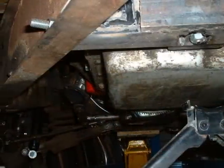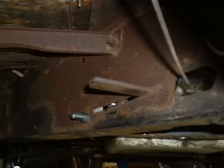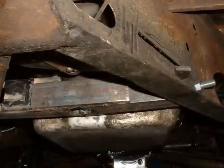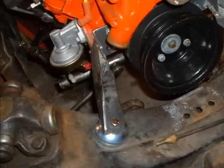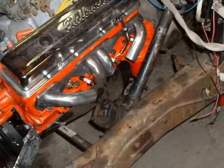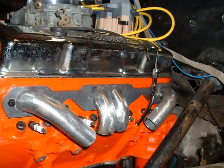You can see some of the detail. I centered the tailpiece in there where it had to go in the X-member. I put the engine in and left about an inch between the distributor and the firewall so I can get my hand back there. Here are the front engine mounts — I tried to use the clamshell ones but couldn't figure out how to make them work around my steering, so I built my own. On the first run they bent from the torque, so I had to pull both mounts and sister all the members up with more steel. To date they haven't bent.